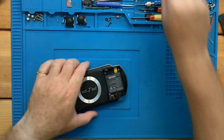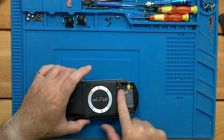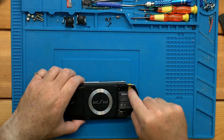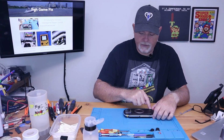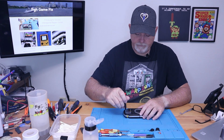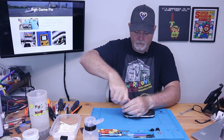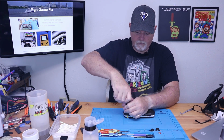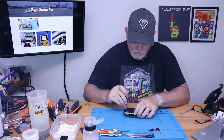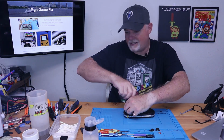First thing to do is just get the battery out. And normally there's a warranty sticker right across the bottom here. Obviously this one's already been into. So we only need to remove these two edge screws and these two from the case. And they're just standard Phillips. So a small double-aught Phillips should be able to take them out no problem, unless they've been cross-threaded. We might have to deal with that one in a second.